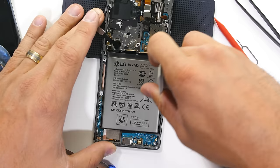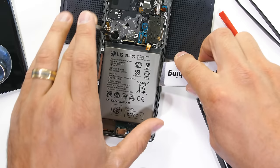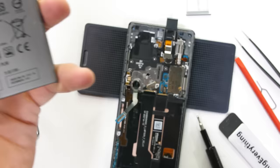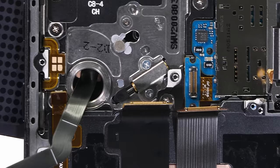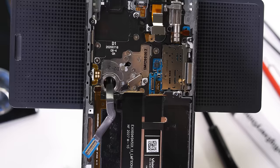I'll take the battery out next before we try to remove the wing. There is an incredibly reasonable amount of adhesive holding the battery down — no magic pull tabs, but it does pop up easily with a pry tool. It has a 4000 milliamp-hour capacity. We have a few more revelations about that hinge from this vantage point. The little doohickey that cushions the hinge opening is right here next to the display ribbon — it's the smallest hydraulic damper I've ever seen.